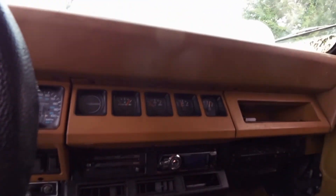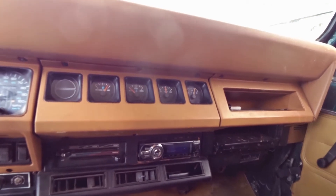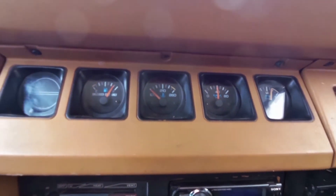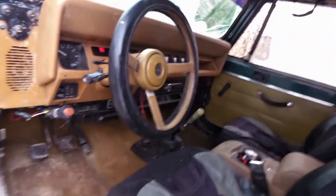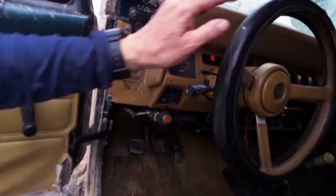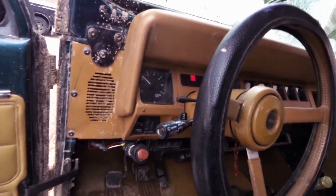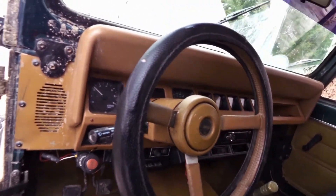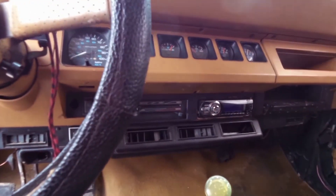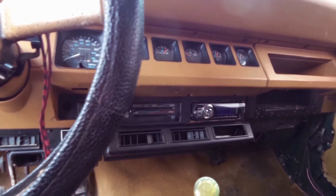Boom! It's cold — no trick to it. I didn't have this thing pre-warming before starting it up. It's at high idle right now because it's cold weather, but I solved the problem. It was my ECM. So if you're having an all-crank no-start when the weather's cold, put that hair dryer on that ECM for about five minutes and see if it fires up. If it does, that's your problem.